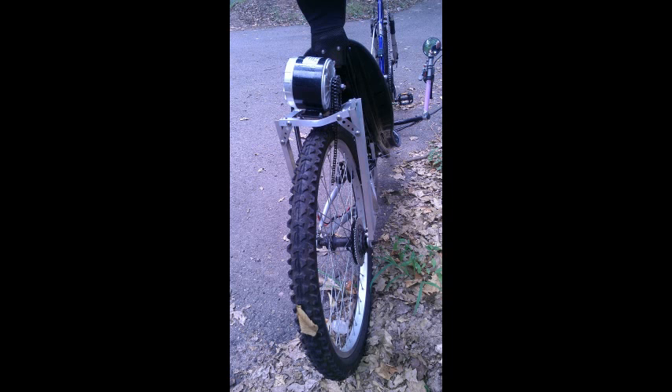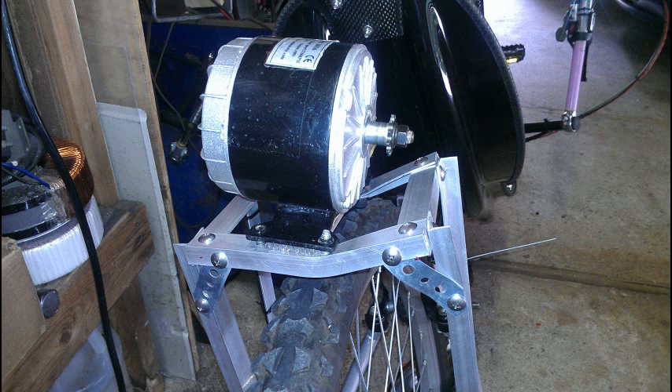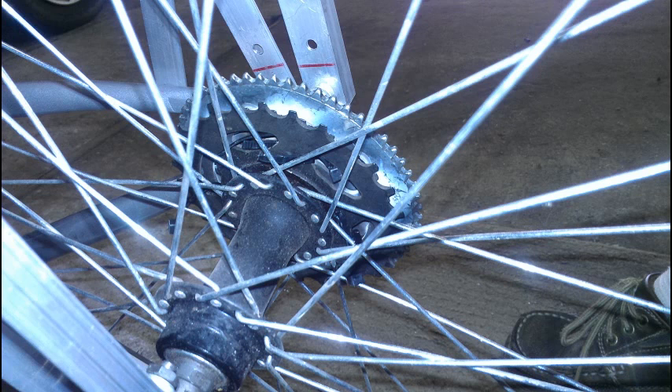Here's what happened on my first test drive with the newly assembled motor frame over the tire. The chain slipped off of the sprocket, wrapped around the spokes, and when it did that it gave a good yank on the sprocket of the motor and twisted the frame quite nicely. Here's a close-up view of the bent and twisted metal. I did rebuild that, but I don't know if I'm going to stick with it. Looking through the spokes of the main sprocket, you can see some tie wraps I was using to secure the cassette from freewheeling inside the hub — three tie wraps that ended up ripping apart once the chain wrapped around the hub.